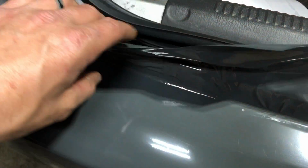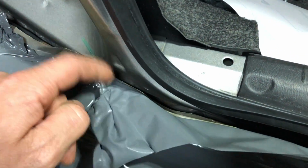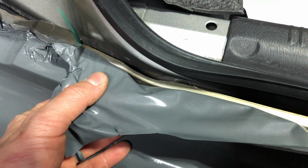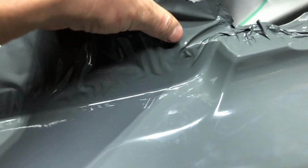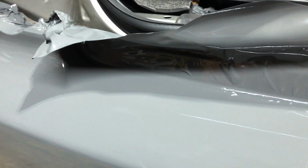Well, I think I did such a good job that I'm not going to use this knifeless tape that I laid out. I'm going to try to pull back the vinyl a little bit, pull off the knifeless tape, and then wrap all the way up until this part. Everything looks pretty flat, and I can make it look good. So let's see if this works out.